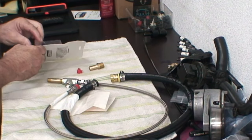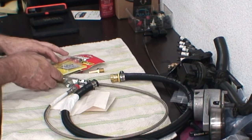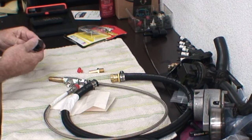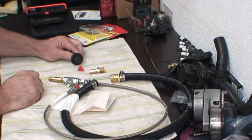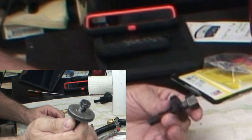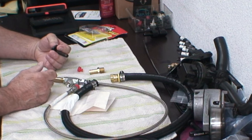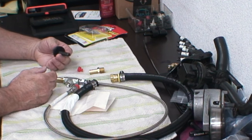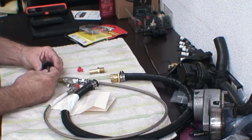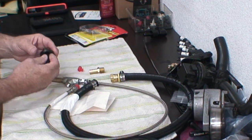We did have another setback. As you can see, I'm pulling out a new harmonic balancer bolt — it's a Moroso. I kind of chewed up the bolt that was in there originally trying to turn the motor over. There's really not enough head on the original, whereas this one has more head. I also forgot I thought I had it out of gear but I didn't, which made matters worse. So we're replacing it with this Moroso harmonic balancer bolt.